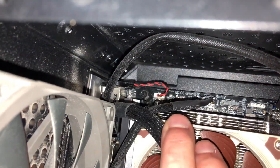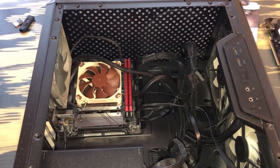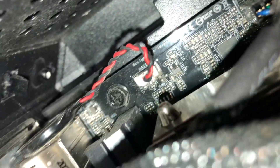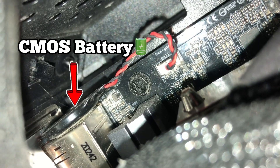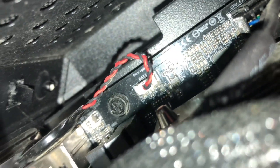In this case, it has a red wire and a black covering. I'm not going to remove the battery because it's not defective. But if you did need to, it's clipped in, so you need to pop it off with a clip. But right here, I'm just going to disconnect that plug and let it idle for like five minutes. That way, the motherboard will reset.